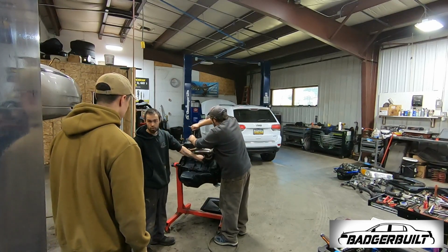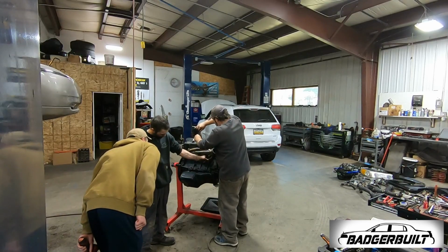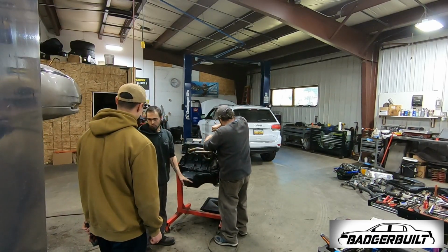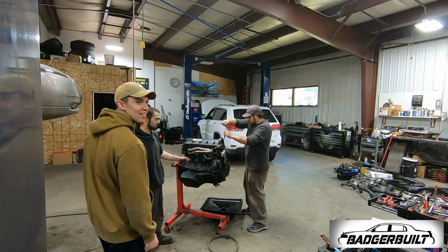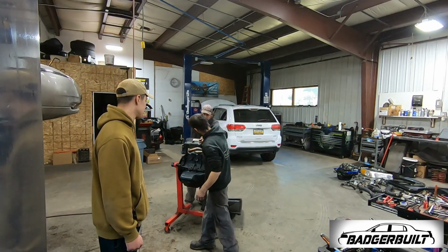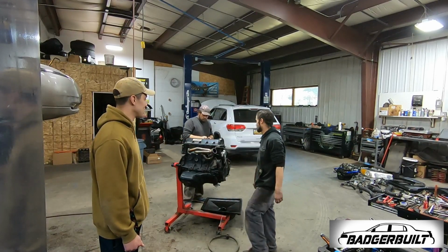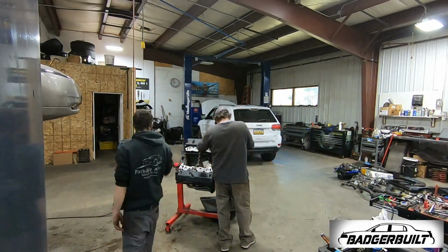That one kept coming loose and it had a snapped off Allen socket in it. Now we made a long bolt, welded a nut there. Easily serviceable in the car. It was never that before. Just got done retorquing the head studs on this head. I have to do the other head still. They come out good? Yeah, they were all still at 70 foot-pounds. I'm sure when someone plants the idea of it loosening, you kind of just start fingering your head. It had to be checked.